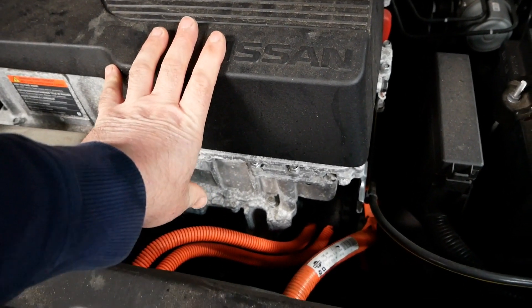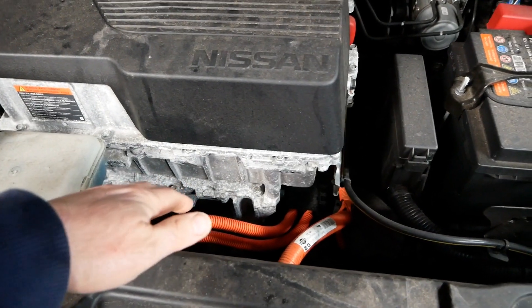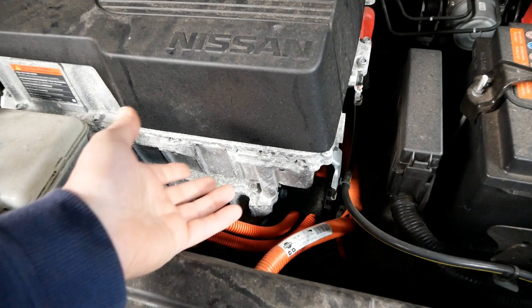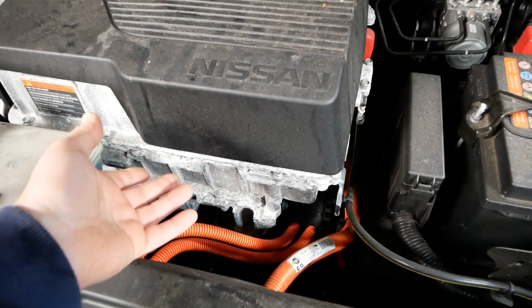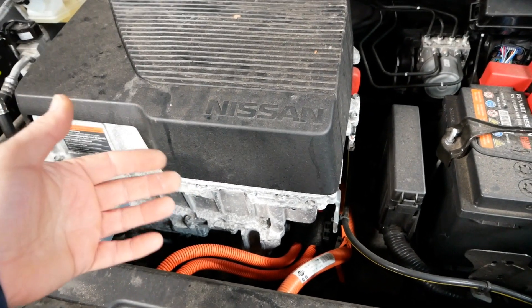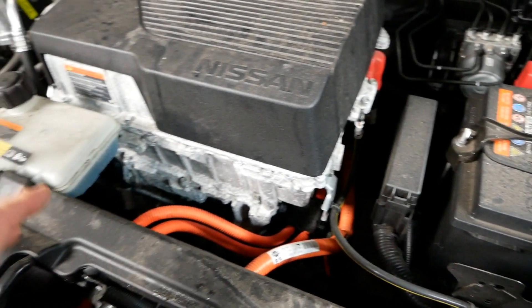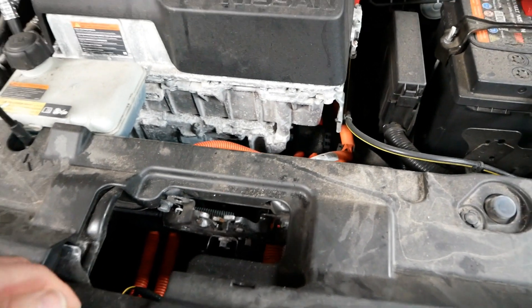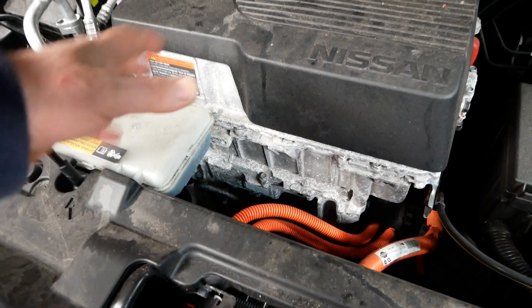This lot here is your engine — your electric motor stack. At the bottom we've got an electric motor that is powering the front wheels, and then on top of that all the other electronics are inside these aluminium enclosures. That will be your charging system and your inverter, and it's all water cooled. At the front here is a radiator and we've got a coolant bottle, pumping water around this metal enclosure to keep everything cool.